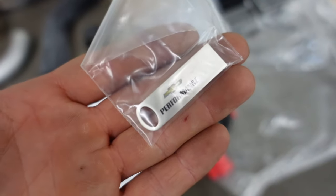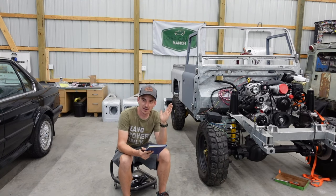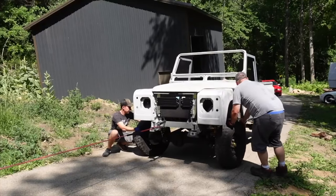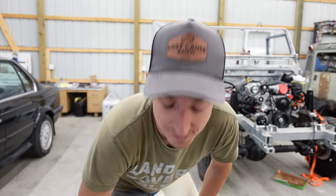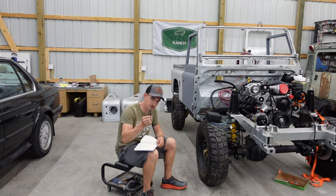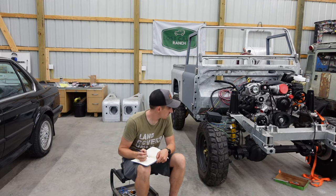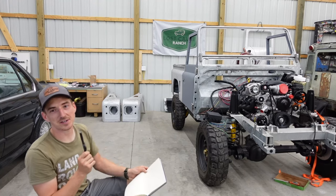Today was mainly a fact-finding mission on what we need to do to get this guy running and our line of dominoes falling. We're two or three hits away from ordering another round of parts — some steering bits so this is less awkward to move around; should have done that months ago. For wiring, we're actually pretty close. We have our wiring harness sorted, with the exception of needing to figure out the MAP sensor connector — that kind of sucks that it doesn't work. We also need to figure out which O2 sensors the kit is calling for and get those ordered. Outside of those two things, we actually have everything here. The one other thing before we can finalize the wiring is to pull some dash pieces out — the dash is going to be a custom setup but will follow the stock packaging layout and style very closely.